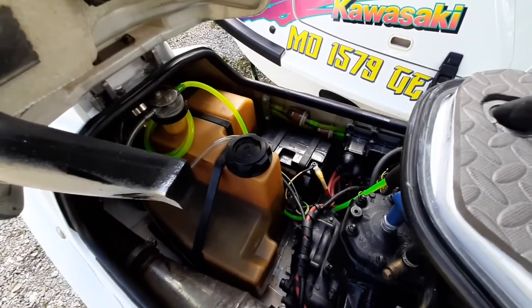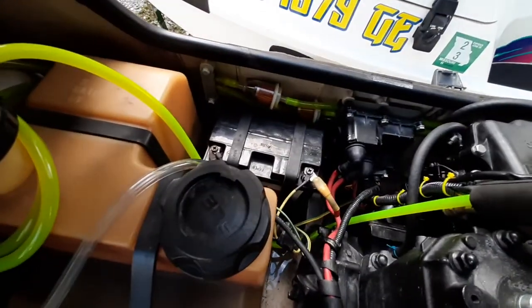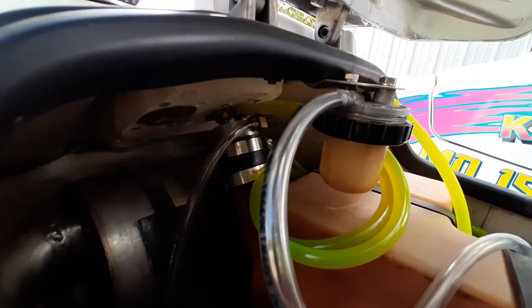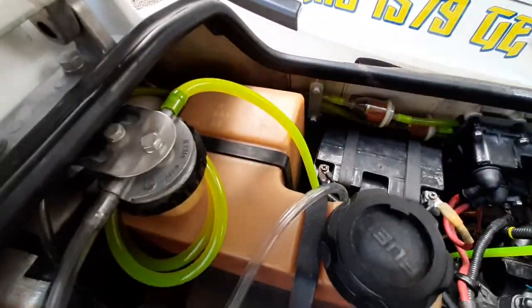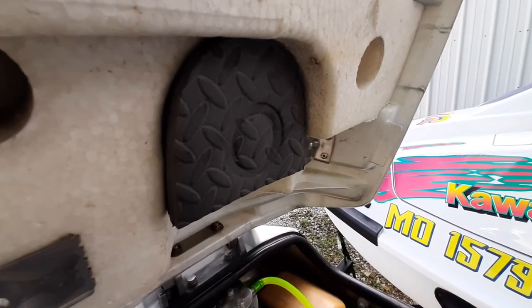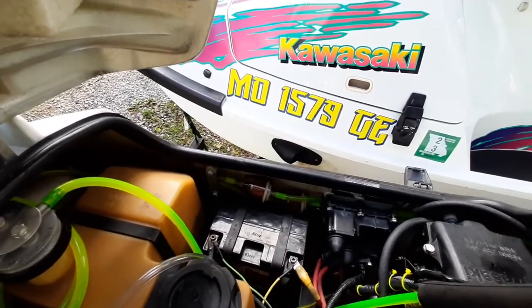One other thing I did: when I changed to top fill, you fill it right here where the normal pickup tube is. I moved the pickup tubes up front where the filler neck originally was. The problem is the filler neck also acts as a support to keep the tank from moving, so that left just the two rubber straps and it bounced around a bit. What I did was stack up some foam and place it there — you can see the indentation that presses down on the gas cap when you latch the hood, and that keeps everything nice and solid.